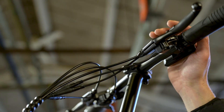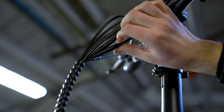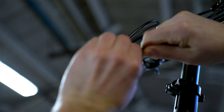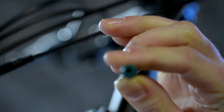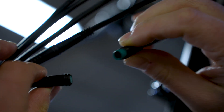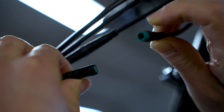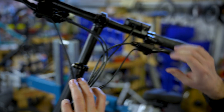At the front of the bike, coming from the brakes and the handlebar display, you'll see these connection points at the top — they're called Julett connectors. If I pull one of these apart you'll see that inside there are very delicate little pins. On the green one coming from the handlebar display there's a series of pins, and these meet up again with an arrow like the motor cable does. Just make sure these are connected well, the arrows meet up, and if you do disconnect this just make sure the pins are nice and straight and when you reconnect it the arrows meet up again.